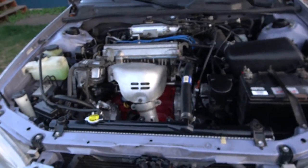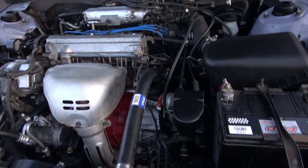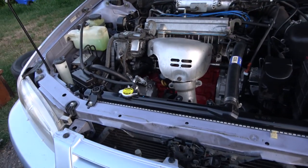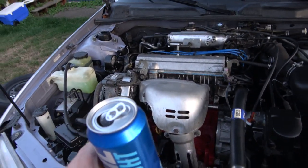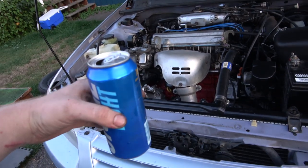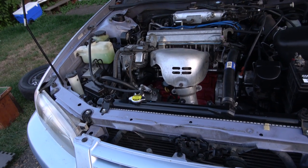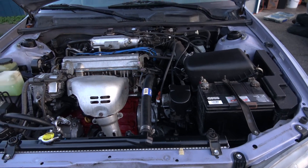It has to have a lot of air in it. So I'm just going to keep filling it up until it stops accepting coolant. Right now I think there's so much air in there, the water pump's not grabbing it, so we're not really getting any flow. The water pump that we put in there, I did check it. It's metal on metal, a solid water pump. There should be no reason why it's not flowing coolant, so I think it's just because of the air.